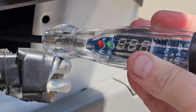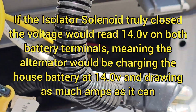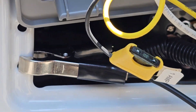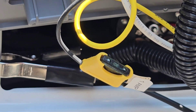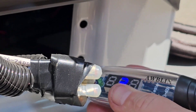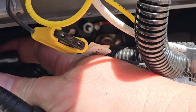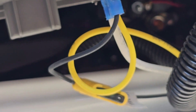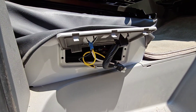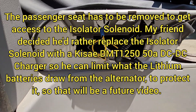See how that says 14 on the chassis side, but when I go to the house side it says 13.2 — so you have a bad isolator solenoid. That needs to be replaced. All that isolator solenoid does is close to join the two batteries, so you should be reading 14 on both terminals. If you're not, the isolator solenoid didn't do its job — or it could be the isolator delay relay, but I don't typically see those fail. I see the isolator solenoid fail.